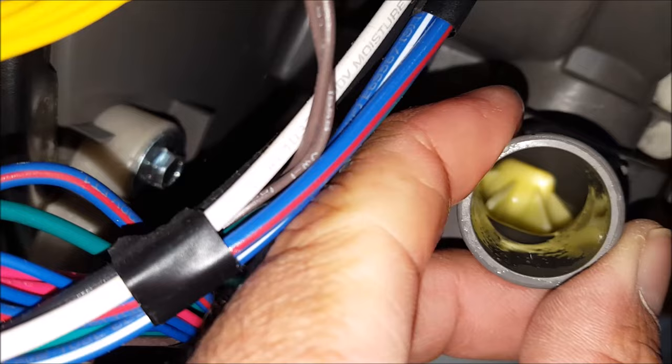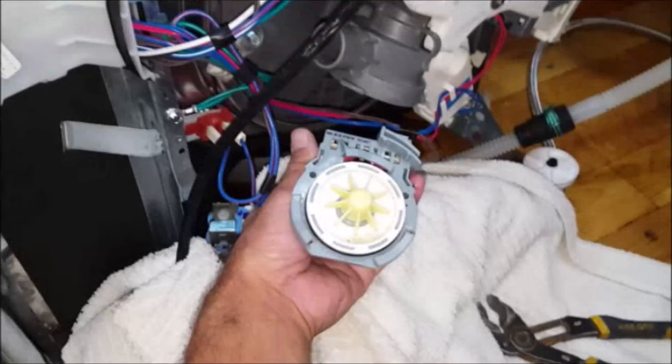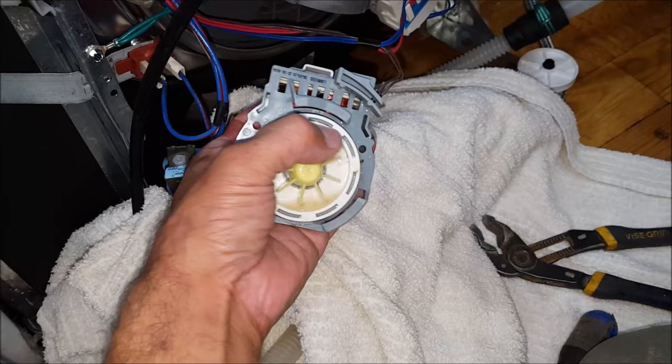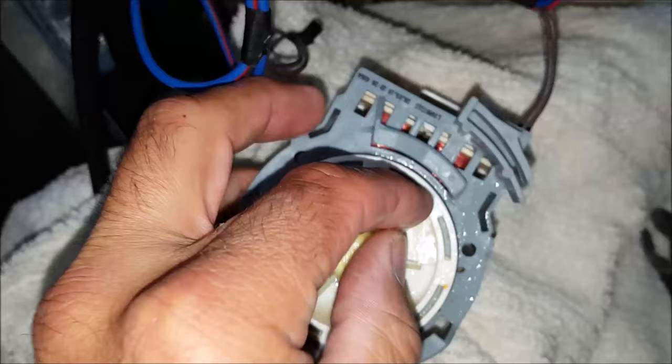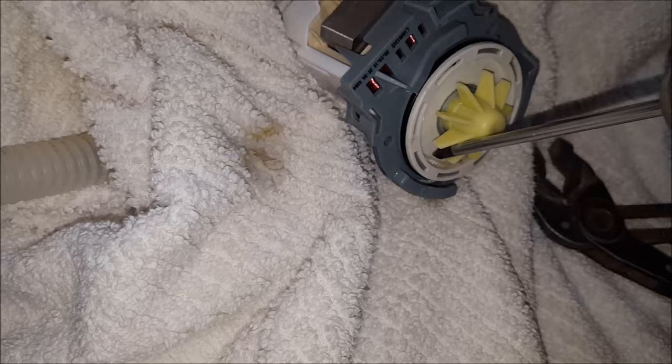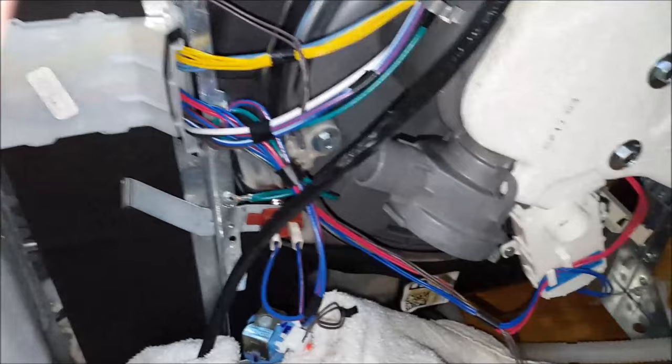I feel nothing with my finger, but I did notice the impeller is not spinning very freely when I tried to manually spin it. So something must be inside this drainage pump. If you have a KitchenAid model dishwasher, you might get lucky and find that the pump comes apart just by twisting it. For most other models, the pump will more than likely have screws securing it together. And it looks like I finally found what the issue is with this dishwasher — there's a piece of glass right here. This small piece of glass somehow made it through the screen and filter and got stuck inside the drainage pump, causing the impeller to become stuck and spin very slowly, which is why the drainage pump was not working.